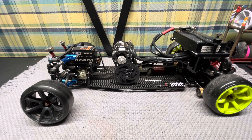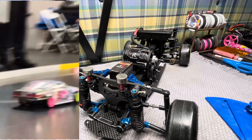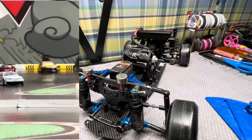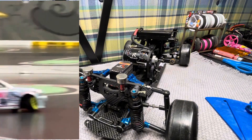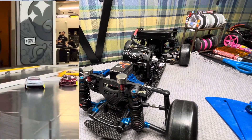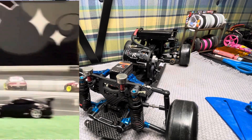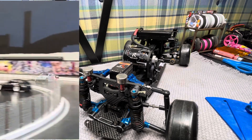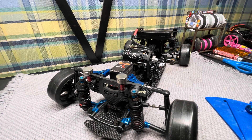So what does camber actually do? Negative camber will assist in stabilizing the chassis in the direction of the lean. For example, if your camber is zero or neutral, the chassis will want to always drive straight and is mechanically less stable than having negative camber. However, it is very important to have left and right camber exactly the same — otherwise the side with less camber will pull the chassis toward it, kind of like a brake issue where one side has more pressure.